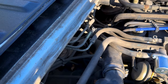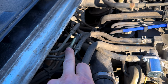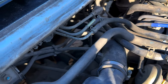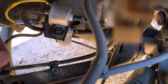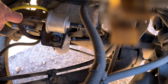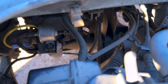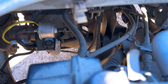I took the fuel feed line from the fuel pump to the carburetor loose here. The key is on — we should have the pump running and priming up the system, but it's not. I think I've found part of our problem because if I reach down in here and wiggle the wires, our pump will start running and we start to get fuel. So we've got an issue with our fuel pump for starters. Once we get that figured out, we'll see if it runs or if there's more to it than that.